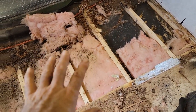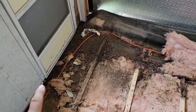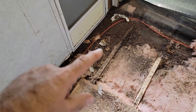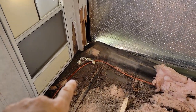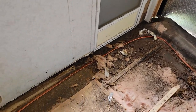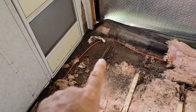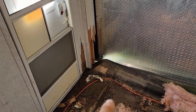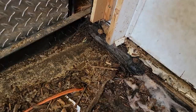There's insulation there, so I'll put some more insulation once it's all done. What I might do is put the frame in and then see if we can figure out where it's leaking from — run a hose up there. It might be leaking on the outside, coming in around the frame and down here. Because the camper sits most of the time at a little bit of a slope this way, maybe that's why this side rotted more. We can run some water on it and see if we get any leaks, so we'll know if we don't have it all sealed up.